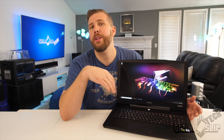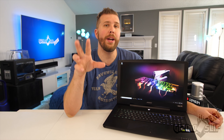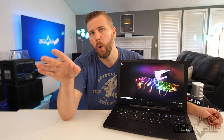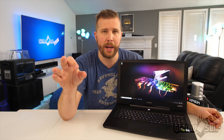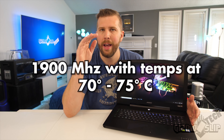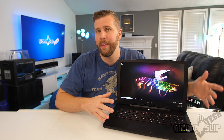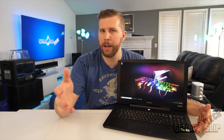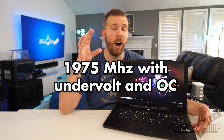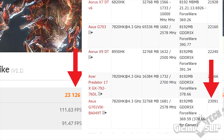It is not thermally throttling; it would only throttle if it hit upwards of 90 degrees. The only exception to overclocking to 4.3 GHz is having an AVX offset, which means when rendering video, it downclocks two stops to 4.1 GHz across all cores. As for the GPU, out of the box it's hitting around 1900 MHz and only capping out temperature-wise at 70 to 75 degrees. After undervolting and overclocking the GPU, I was able to hit around 1975 MHz clock speed, hitting 23,126 in Firestrike graphics test — higher than literally any other laptop currently on NotebookCheck, though of course that is overclocked on this machine.